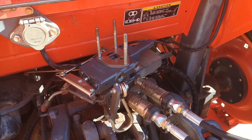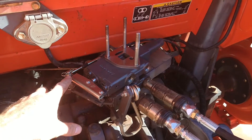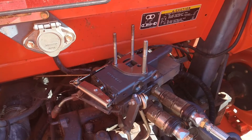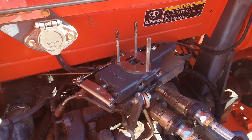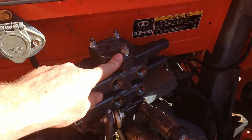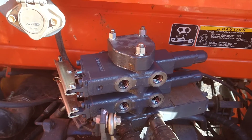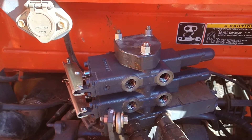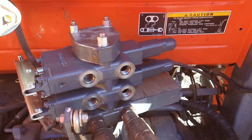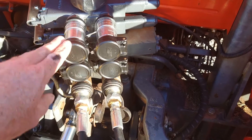Good news — that worked out just like I was hoping. Now I'll rig up the third valve with its hardware and prepare it for the linkage. The third linkage isn't run yet, but at least get everything ready before we put it on the tractor. I got my sandwich built up here — I got the 14 millimeter and 12 millimeter hex sizes tightened up. Now I'm going to put on the couplers and then work on routing the cable before I secure the seat floor. Here are the couplers in place, with these nice little spring caps.